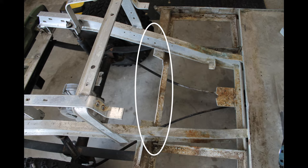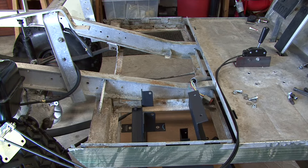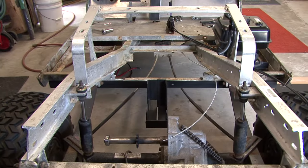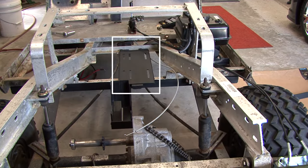This shows where I cut the frame. Here is the mount I fabricated for the gas tank and the shifter is mounted too. This is a view from the rear of the cut frame. Now you can see the fabricated crossmember and transmission mount and the modified engine mount.